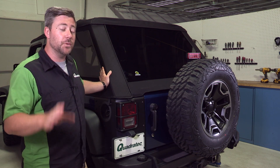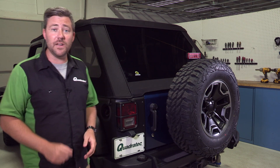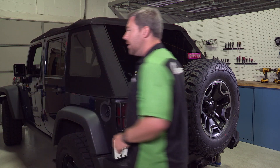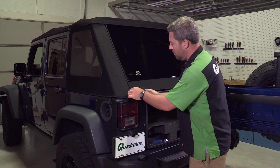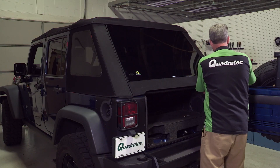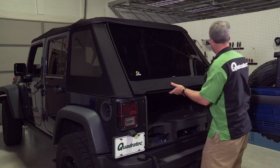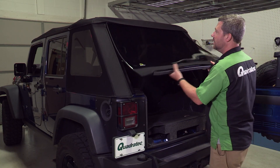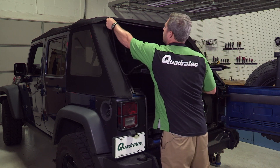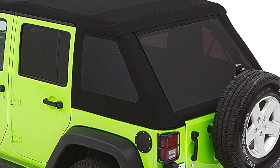One of the really cool features with the new Trek Top NX Glide is the fact that Bestop has completely eliminated zippers on this soft top. When you want to open up your rear window, simply open your tailgate, remove the belt rail retainers at the bottom, and simply peel the channel apart from both sides. Then slide your window right out of the soft top.